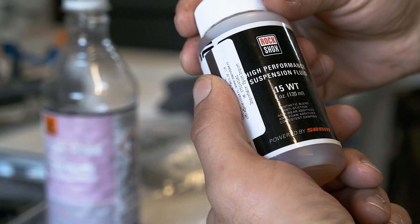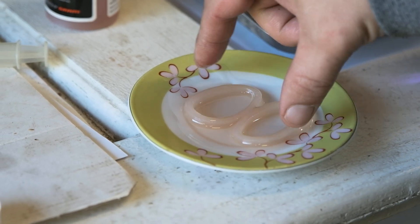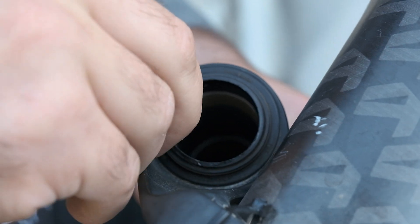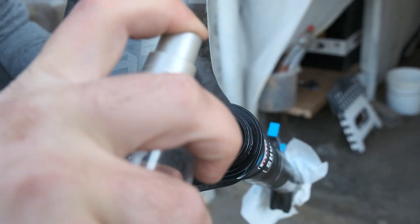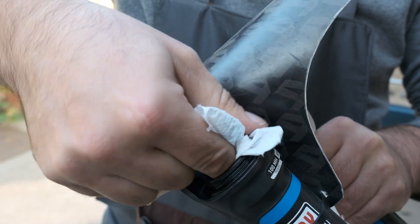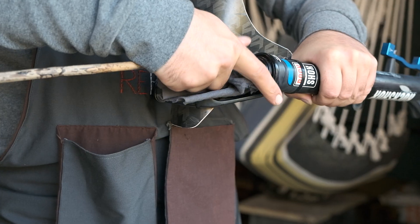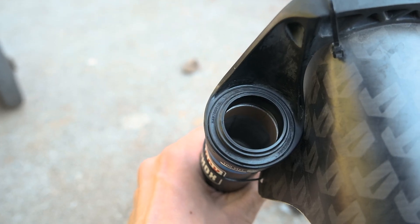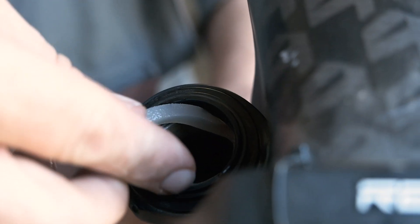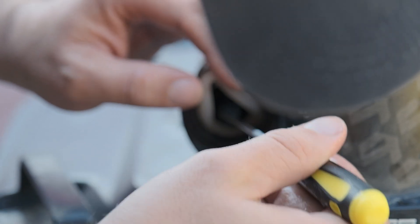In this case I can clean them with isopropyl alcohol and let them dry out, then soak them in some RockShox oil before placing back. But I'm using new foams this time and the used ones will be kept as spare, so I just place the new ones in RockShox oil to soak completely. Now get back to the lower leg cleaning. Remove the metal ring from the rubber seals and use some alcohol to clean the oil and grease from the inside and outside. Then find a long stick covered with a rag and stick it into the lower leg to clean the inner side as well as you can. Take your time here — it should not be dirty at all if you are doing maintenance regularly, at least twice a year. After this is clean, check the foam rings — if they are nicely soaked with the proper RockShox oil, it's time to insert them back. Maybe this is the hardest step in the whole process, so be patient — they should stay in place without any twist.